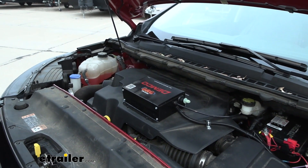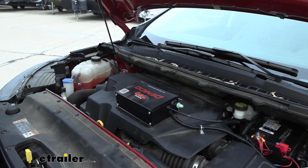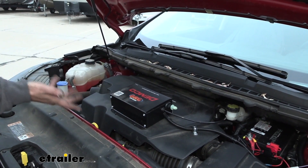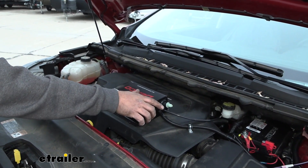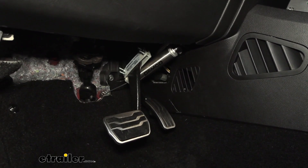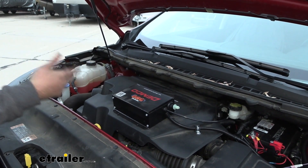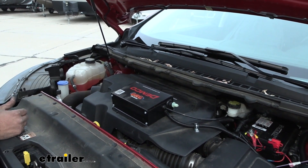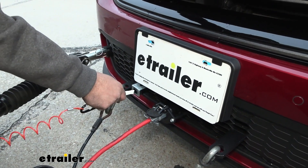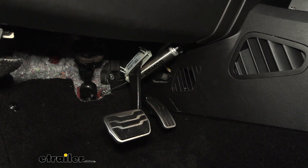The braking system is operated by a cylinder mounted on your brake pedal that pulls towards the firewall when you put the brakes on the RV. All the brains start at the main unit, which we've mounted in the engine bay — that's normal for it to live here. It has an airline that runs to the cylinder mounted on the pedal, as well as electrical wires that tie into our G-Force controller, which allows brakes to come on as the G-force moves, and also to our breakaway switch. When the brakes are applied or the breakaway cable is pulled, you'll hear the compressor kick on and the brake pedal will start applying.